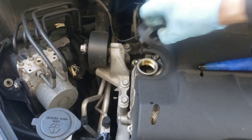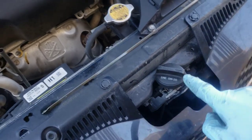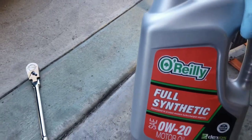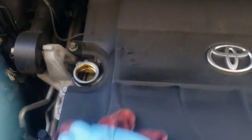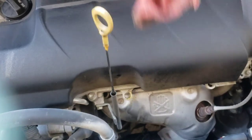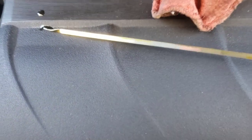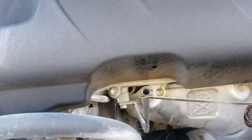Take the cap off. I like to always put the cap right here on top of the hood — that way if I forget to put the cap back on, the hood won't close. Here's our oil, 0W-20. I poured that whole jug in. I don't know if five quarts is enough for this vehicle or not. Let's see where we're at. It is between the two dots, but I might want to add a little bit more.